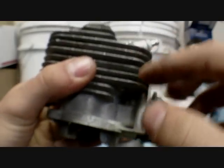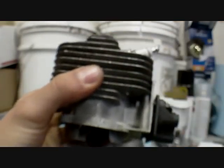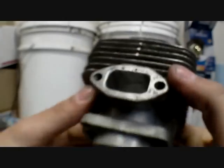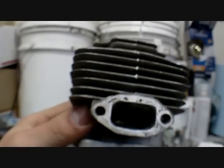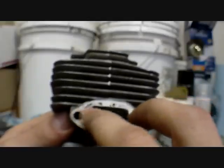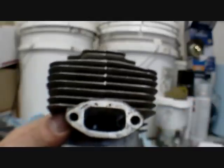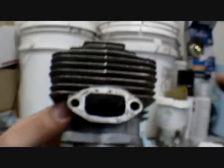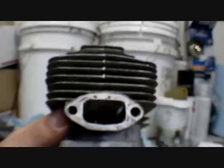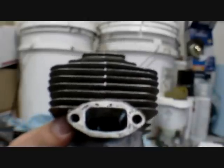Now for the exhaust, you can raise it. Raising it changes the timing as well, and lets the combustion gases flow through at a sooner rate. Ultimately, rounding out the ports will create this effect as well, because it'll raise and lower. But if you focus only on the side walls and round those out, that will not be an issue. Doing that would probably be my best guess if you don't know exactly what kind of mods you should do to your bike.